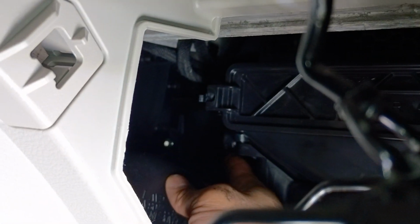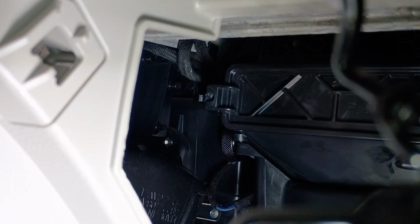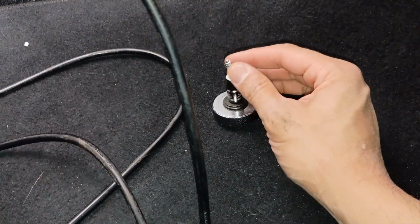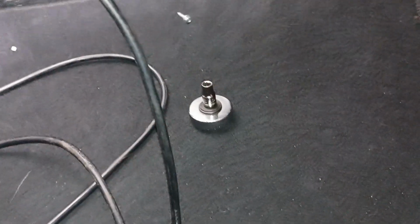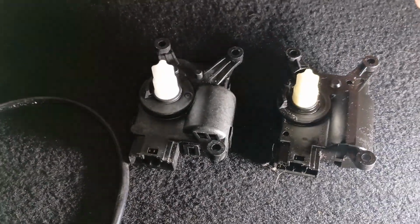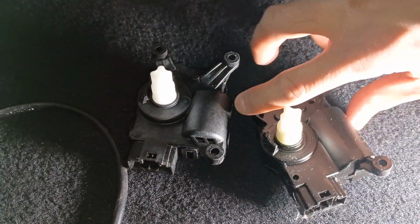You can see the thumb wheel right here on the bolt. So the first one's out. It's pretty short. It is a 5.5 millimeter bolt head. Video from underneath showing where the thumb wheel has to go to get the other bolt. Once that bolt was removed, the part pulled straight out.